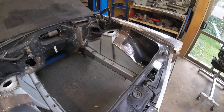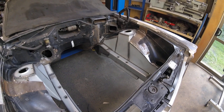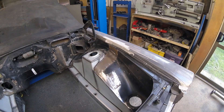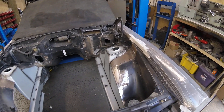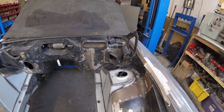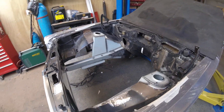The passenger side is very close to being complete as far as the metalwork goes. There'll be some bits and pieces going on to that bracket at the bottom towards the rear and front, and there are a couple of little gussets missing at the top and some holes to fill. We also need to work on what's happening with the air system — there was obviously a big fan that sat between these two holes. It sucks from the top and blows into the bottom, going into the cabin, so we've got to do something different with that setup.